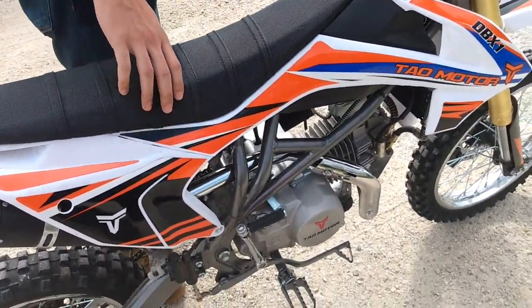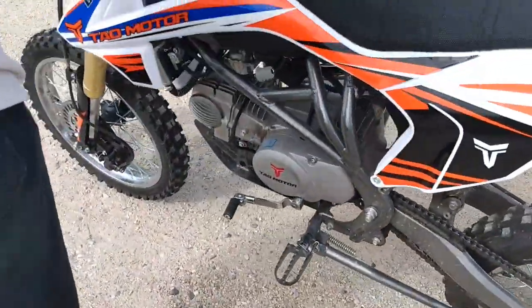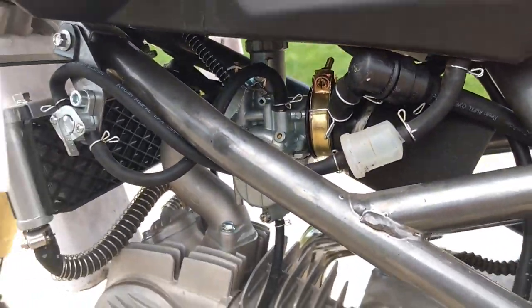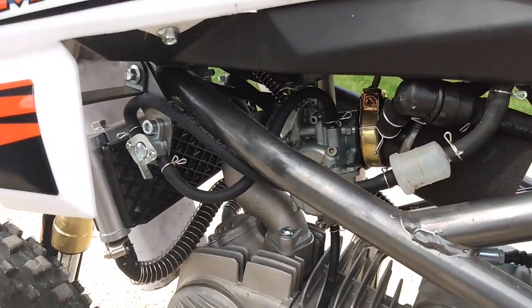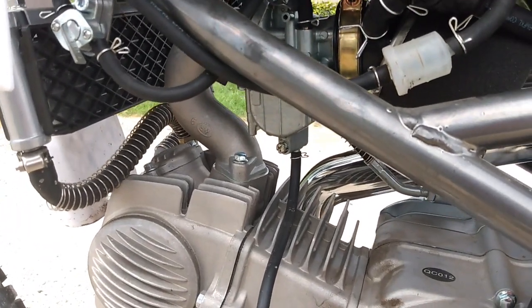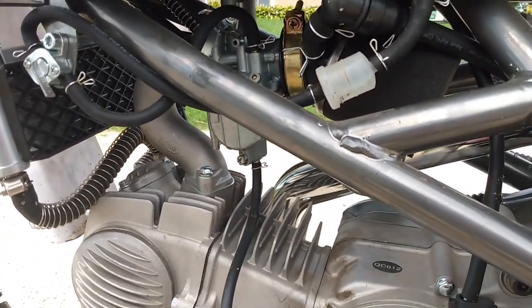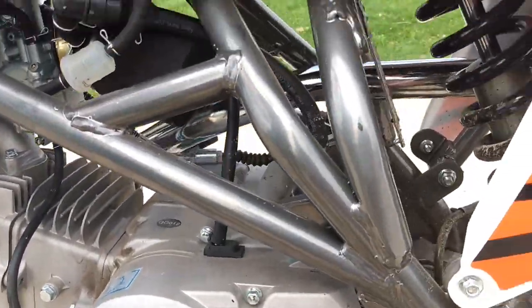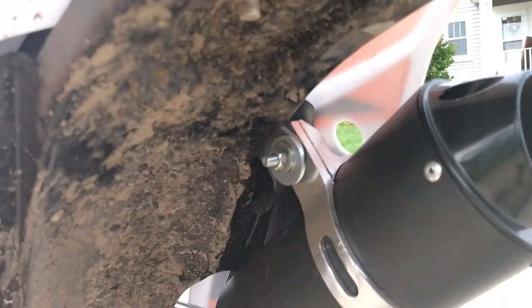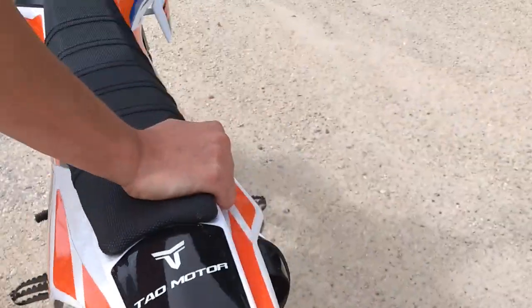It has the power of a 150F — torquey as hell. This Mikuni just has an arm choke, whereas the stock carb had a different style choke. This is gonna be a little different but it's basically a bolt-on replacement — you didn't do any modification, pretty much plug-and-play with the same air filter and everything stock. The pipe just slips on with a clamp and a bolt onto your exhaust header from the engine.